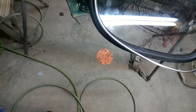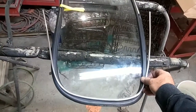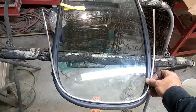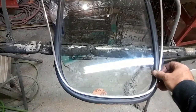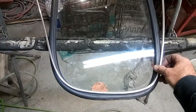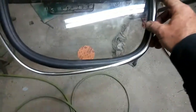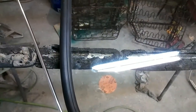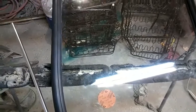The thing that I found — that he showed me — is that if you look, you see how these fit like shit. What you want to do is carefully — and these things will tweak so easily — carefully bend these to the exact way the groove is. Line it up, start right here, bend the molding so that it fits exactly where it's supposed to go. It makes a huge difference in installing it.